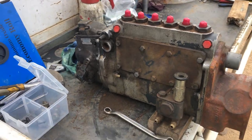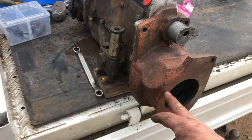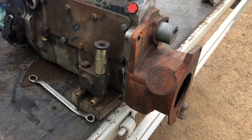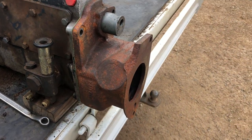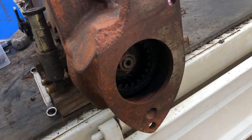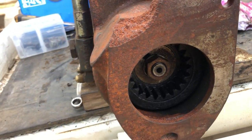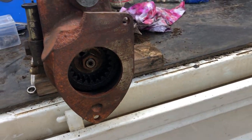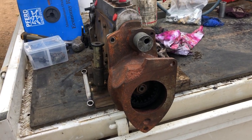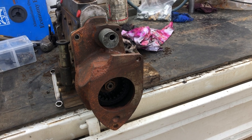This one here is, so I swapped the front housing because this was on the pump that I had done up and this got broken in transit — it's just rusted and sweated a little bit inside the bag. If you look in there, you can see that style of coupling which is Bakelite — that's a little bit later style, probably started about '79 or '80 I reckon. And this one's got the older style steel coupling with two tangs that fit into two female tangs.